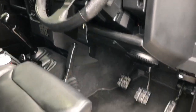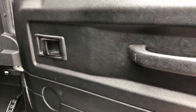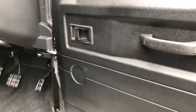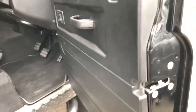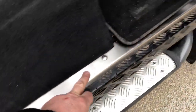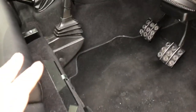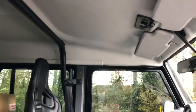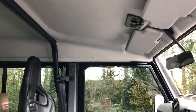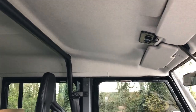Which is what we like to do, so we've soundproofed it firstly — a full three-layer system in the doors, so that's the back of the door card, the whole frame, and also the inner skin of the outer part of the door. We've also added water shedders because they're quite often missing. We've added stainless steel finishes — a nice touch, and we now have them in brushed. We've fully soundproofed the floor pan and the roof, so we removed the headlining, fitted Dynamat Extreme right the way through, and then put 6mm foam over the top of that.